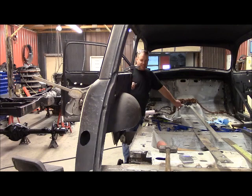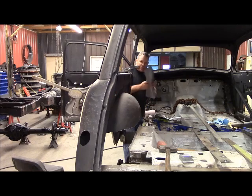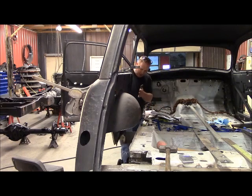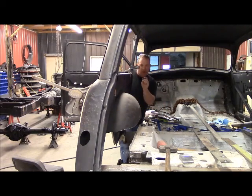Now, I've told you how complex this is, but I want to show you another thing that factors into putting the wood on: it was made at another place, it is oversized, it doesn't fit, and I'm not having any of the bottom of the truck in because it was either wrecked or smashed or damaged, so that's all gone. Not having another woodie to get any measurements or references off of. As I'm installing this metal here, when these posts went down, it shoved these sides out. So this lower side in the front and the rear, I'm having to tune with this strap here. I've got it pulled in about that far. Now I've got it perfectly in line with the frame, and that's where it was on the woodie.